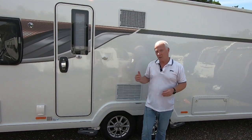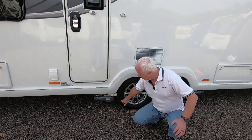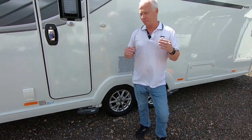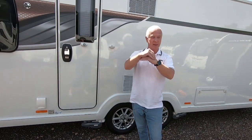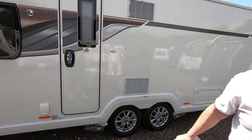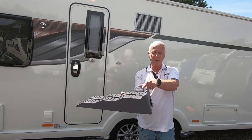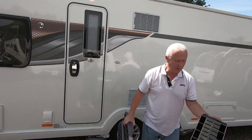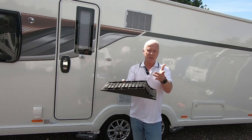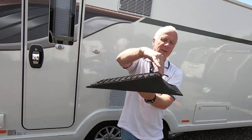The other way is using a ramp system. You put a ramp in front of the wheels, roll the caravan up over the first ramp and then down again. Rather than using the older harsh type where you drive up and drop down, I've found this newer type of levelling ramp which has a nice little dip, so you drive the caravan up using the motor mover and it just rolls down again.